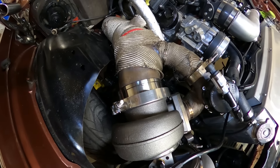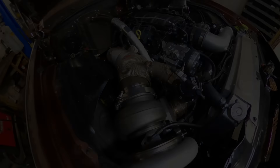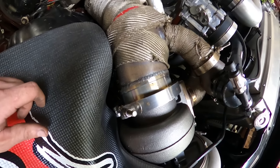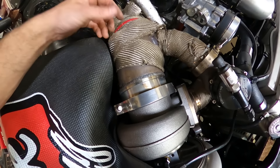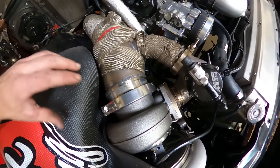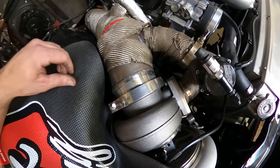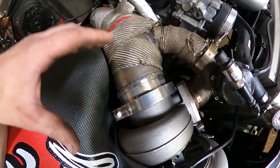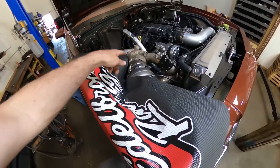As much as we can, pull the downpipe off, weld the underneath of it, and then put it back together. We got some weld on top of there now — it's not the prettiest, I am not a welder, but I think it looks fine. At the end of the day this wrap is going to get pulled back over and wrapped over this anyway. That looks pretty good. I did the top half in the car; all the V-band clamps are tight so it's in place. I'm going to let it cool down before I take these clamps off — I don't want to get it cattywampus or crazy. I'm going to pull the downpipe off, weld the whole thing up, and then put it all back on.